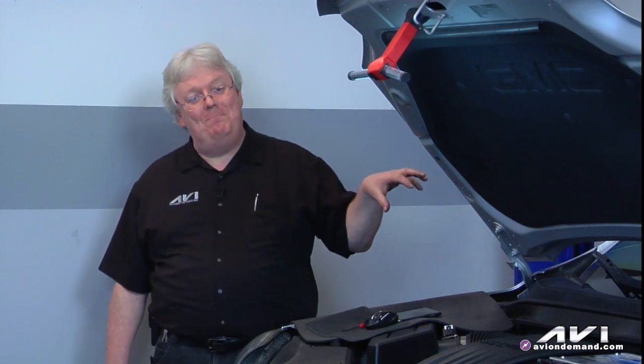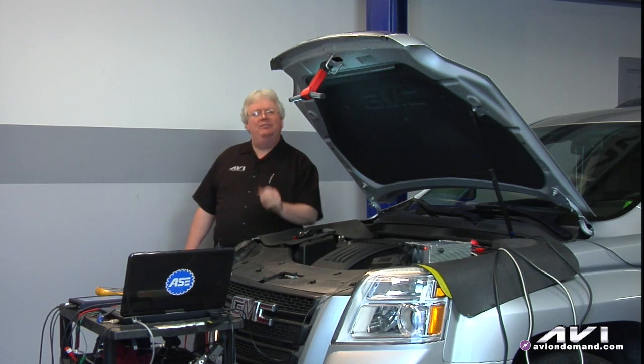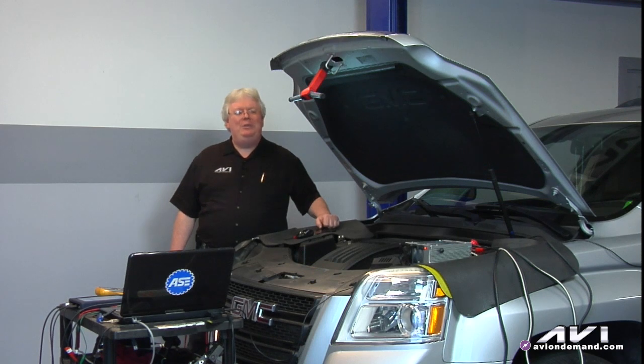I had to power down the high voltage system in order to take the top of the inverter cover off, which was preventing me from getting access to the ABS hydraulic modulator assembly. The thing that looks like the main brain for the ABS is not actually the main brain — the main brain is the skid control unit, a little module under the dash. After concluding there weren't any wiring or ground issues, I looked thoroughly at how the system works. It's amazing how when you have to fix a car, you become an expert on it — you read up and reverse engineer how it all works.